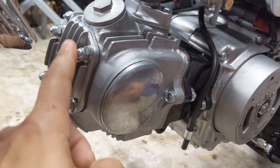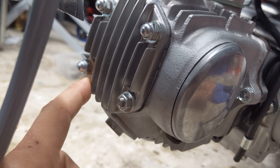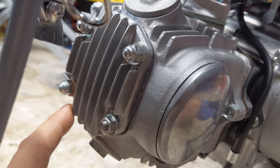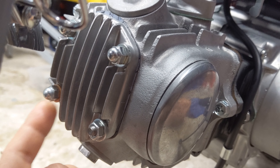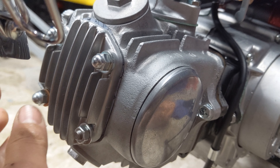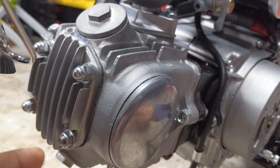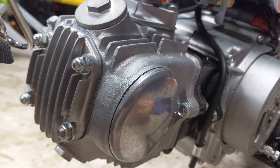A quick note on the studs — these four studs — you should have a copper washer on the lower left. I see a lot of builders who don't put the copper washer in the right place. The reason that copper washer is there is because this stud is responsible for bringing pressurized oil up to your top end. The lower left gets the crush washer to keep everything pressurized and prevent oil leaking. The other three studs are all dry studs — they have no responsibility for any oil and no oil runs through them under pressure.